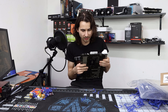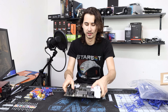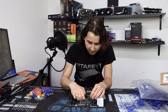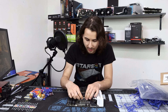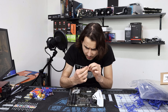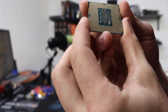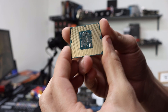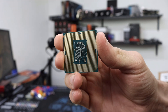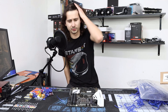So what could have possibly gone wrong with this thing? I don't see anything immediately damaged. I didn't think that he would damage anything, but I don't know if I ever took this thing out of the back after I de-lidded it. There appears to be some gunk on one of these CPU pads. It appears to be some gunk on the CPU contact pad. There was some schmutz inside of the socket too, so that could have caused something.